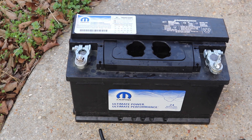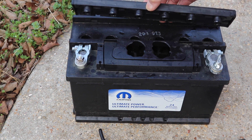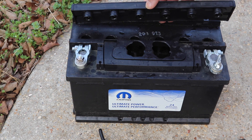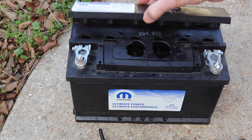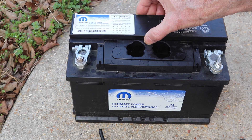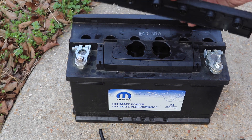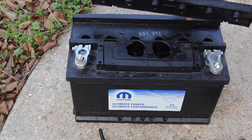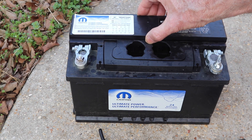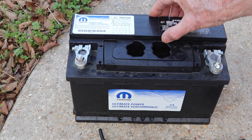I always thought they were maintenance-free batteries — in fact that's what I've always heard Mopar call them. But you actually can check the electrolyte level, the fluid level, the water level in them. This whole cap comes off, as opposed to what you usually see which is individual caps or maybe three at a time. I found that very interesting, because those of you still running these batteries might want to pop that off and check your fluid level. It'll probably extend the life of these batteries. These are not AGM batteries — maybe the newer trucks have them, but these trucks didn't.